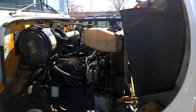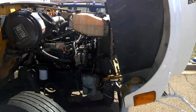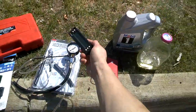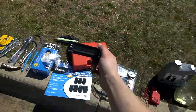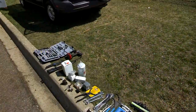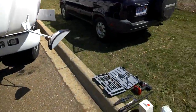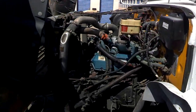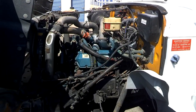This vehicle was giving trouble on the way back from Colorado to Michigan — it was running rough a lot, but then it started dying on the road and not starting. The first thing I did was pick up a scan gauge I got on Amazon for a hundred-something bucks. It not only gives you voltage and oil pressure readings, but it also scans and tells you what codes you're having. I got codes for the ICP, injection control pressure, and the EOP, engine oil pressure.